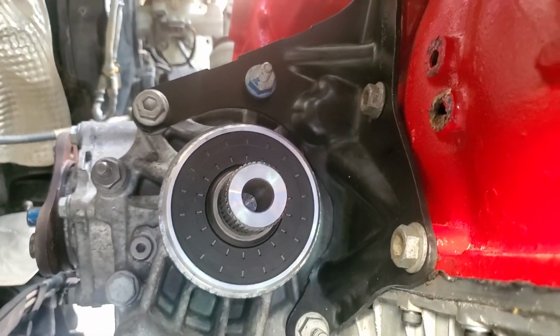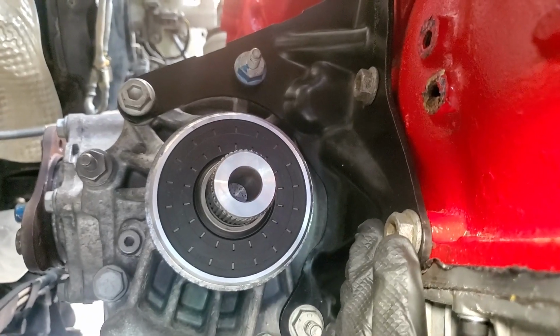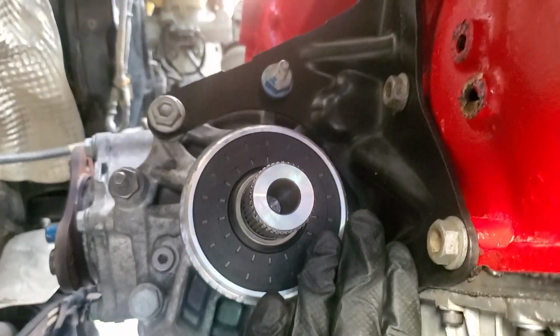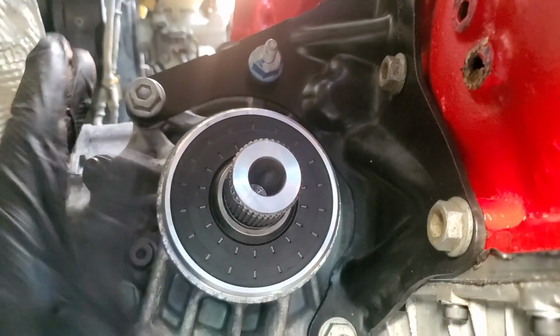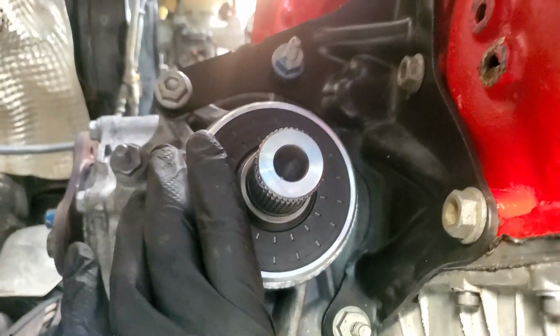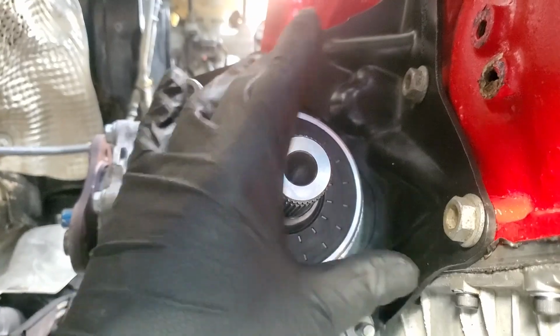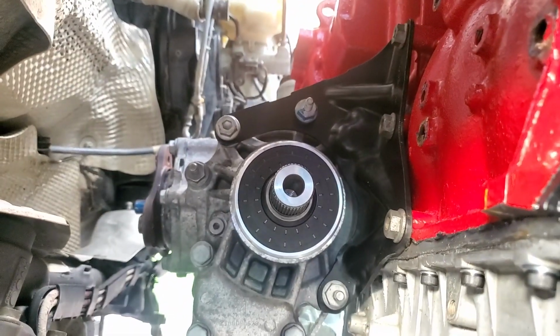We got a fixed bracket. We don't have to worry about holes wearing out, reaming out. This bracket is adjustable too. I can slide it just a little bit to get closer to the engine, or I can pull it back to give more spacing. So I can butt it up tight. I just left it a little bit loose so that I can slide the washer in between. But I can put all 3 washers in position, tighten this up first to get it nice and even across, snug it up, get these snug, bolt everything into position. Nice, great find.